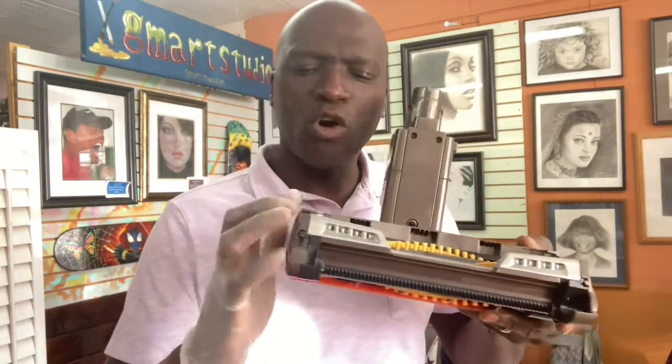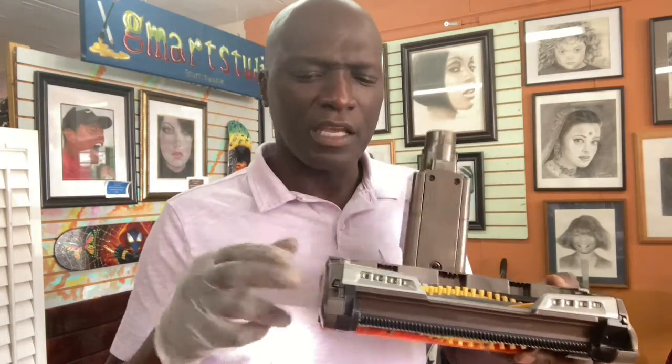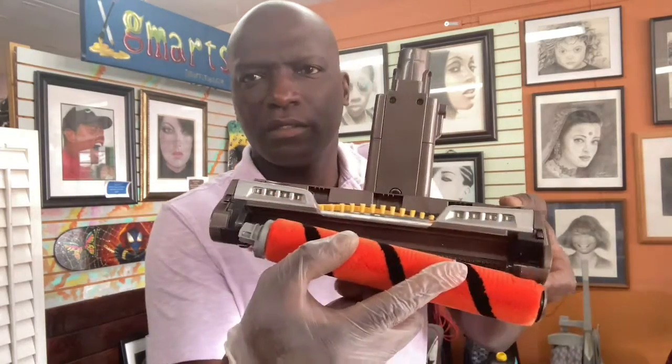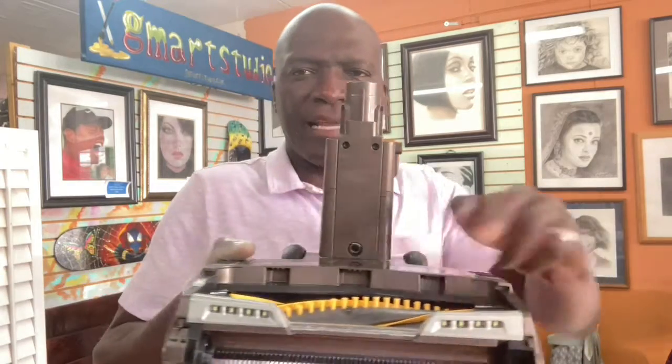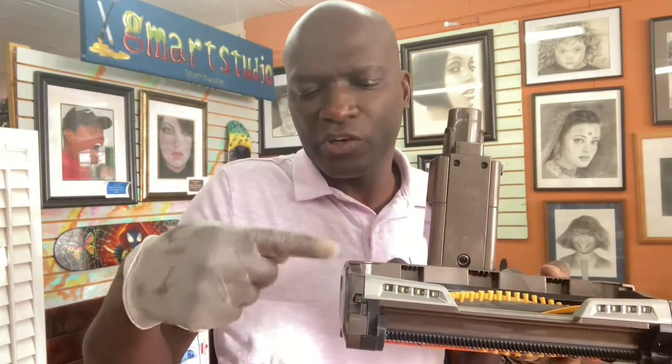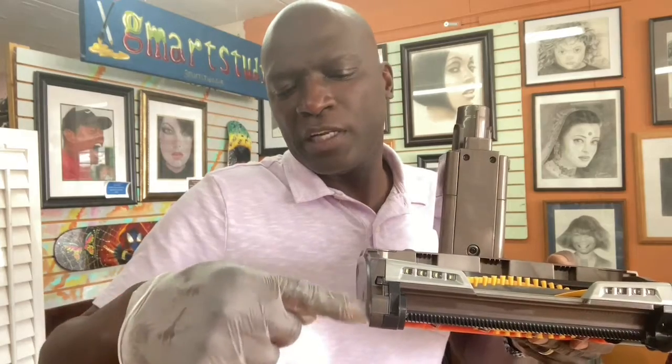And this is the belt that normally goes on this side, because this is the side that controls this, okay? And then the motor side controls the main brush. As this brush is turning around, it's also turning another gear down here for this brush, all right? So let's kind of get through that. This is what we're going to do. I got my screws. I took the first two screws out, tiny little screws like these, with the T10.